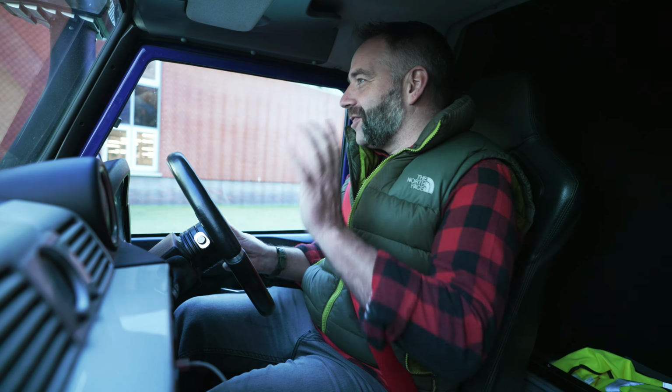What is that? Well, that's the front battery box. As the vehicle is there, that essentially sits onto the old engine mounts. And if you're wondering why there's a cutout there, it's where the steering box goes. So that essentially drops in and replaces the original engine. This box here is 60 kilowatt hours, so this is essentially the equivalent of what's in a Tesla Model 3 battery pack completely. And that's another 40 kilowatt hours, which is the rear battery box. So in total, 100 kilowatt hours.